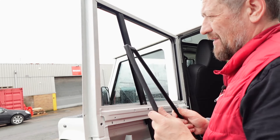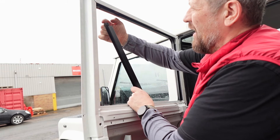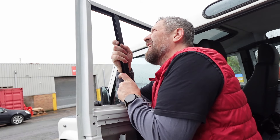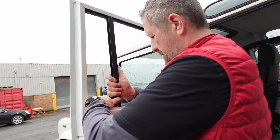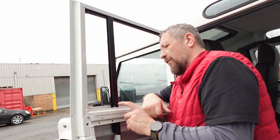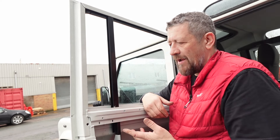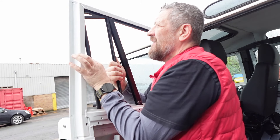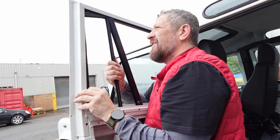I think the only difference is there might be slightly less water getting into the door, but at least ours is galvanized. We've got our support beam, and this top edge locates into the hole up here. Don't be tempted to paint this before you fit it, because it's such a tight fit it gets scratched — I did that on the last one and had to redo it. So this wants to be out — just angle it up there first, then slide that one up, and this one should slide in like that.